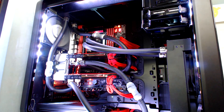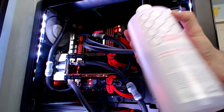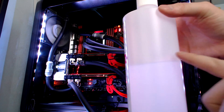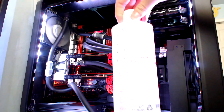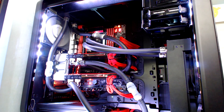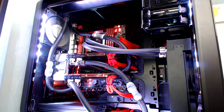Something you will need for bleeding the system is coolant — this is EK E-Coolant Evo Clear, 1000 milliliters. I refilled this loop twice to flush out any gunk from the manufacturing process so it doesn't clog the water blocks. You'll definitely want this unless you're reusing the same fluid. If you think you might change the tubing length, pick up some extra tubing — I recommend the ZMT tubing, it looks really clean in all black and it matches the Predator well.